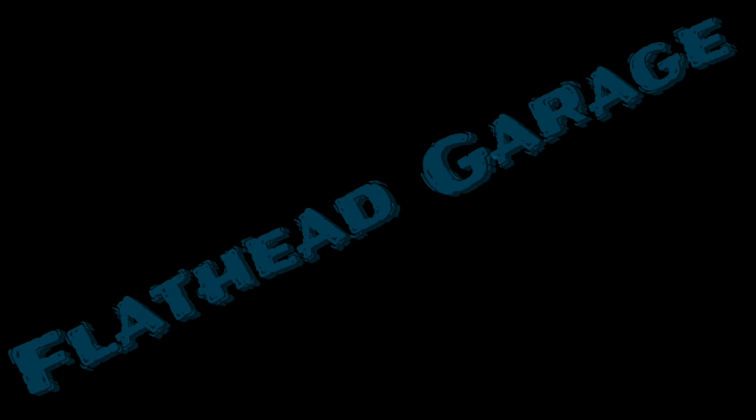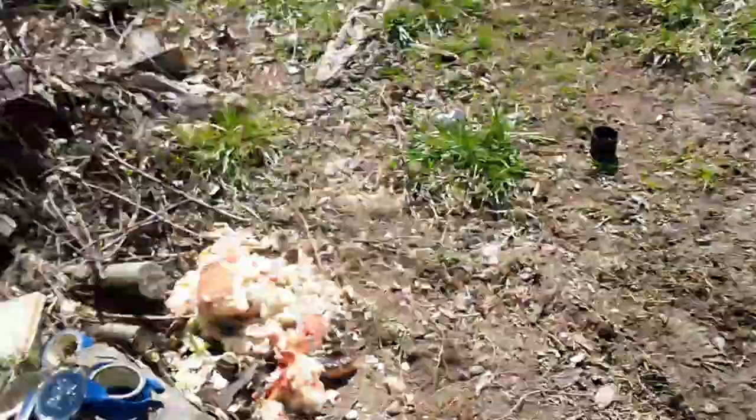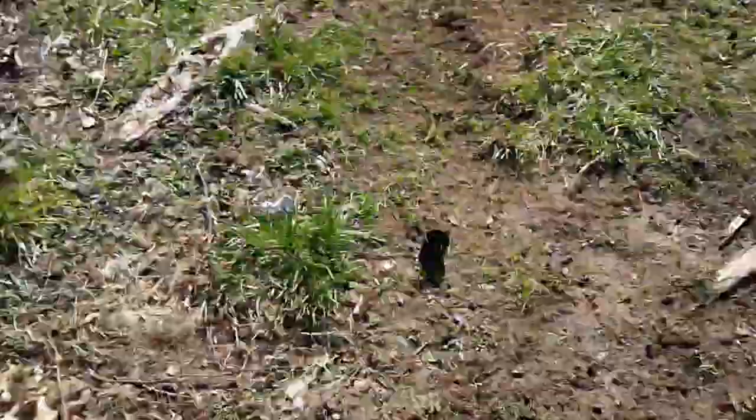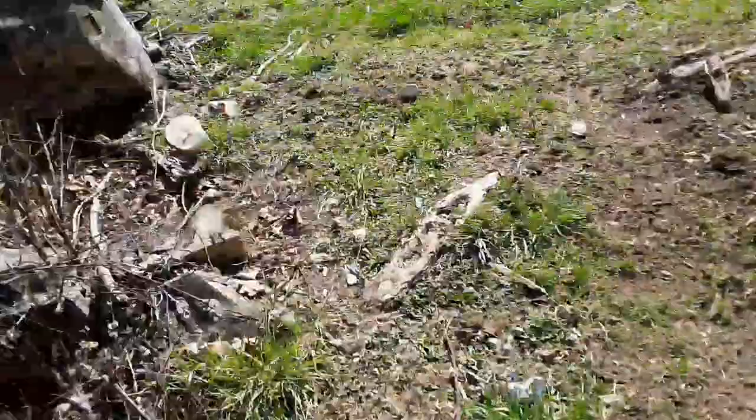We're going to be painting this, and we got Dalton's headlights cleaned. We sanded them with some 1500 grit — well, I should have gone like 2500 grit, something a little finer than that, and then we should have clear coated it. But we ain't got supplies for that and we're just trying to make it look halfway decent because Dalton's going to get some new headlights anyway.